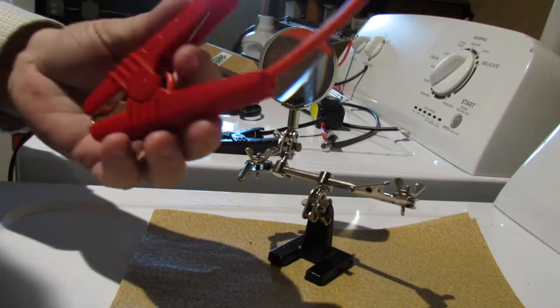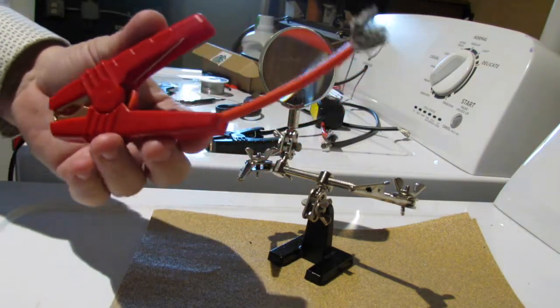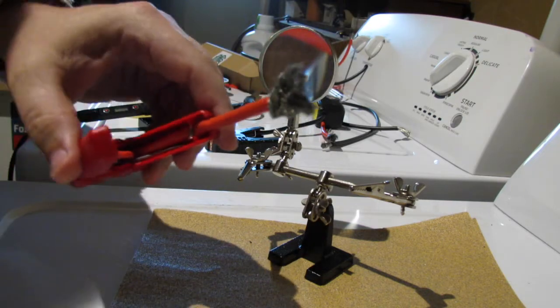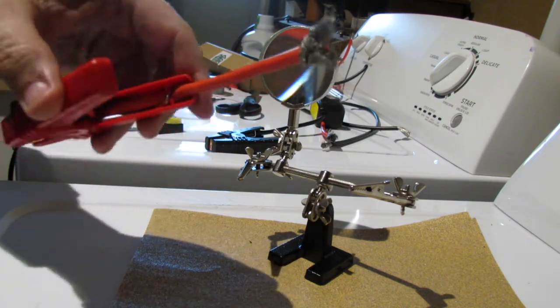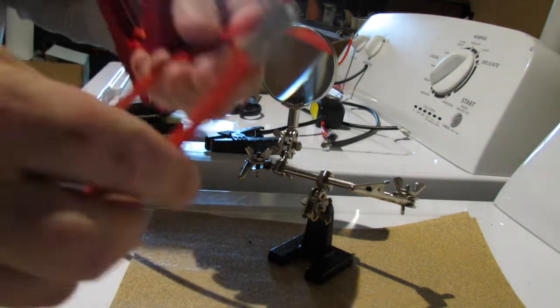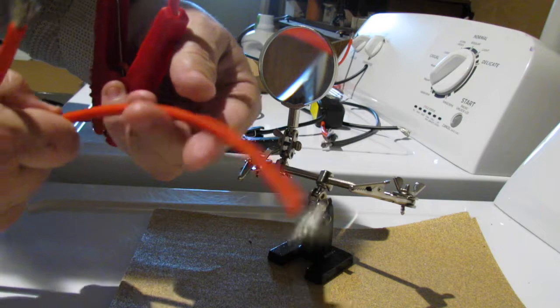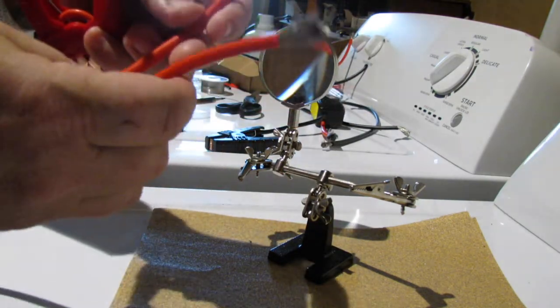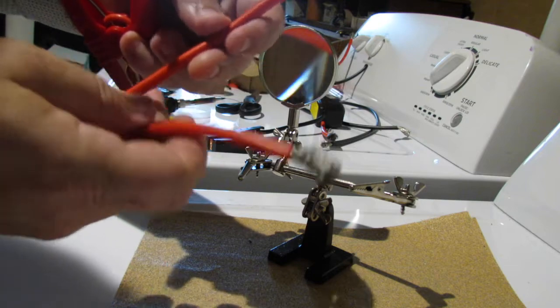This is the FoxPG29. They only give you about 9 inches of wire, and that's way too short because everybody has a hard time hooking up their cables. So what I did was I bought the exact same wiring — 8 gauge 200C. I bought it online, it was like $17.95 for 5 feet of red and 5 feet of black.